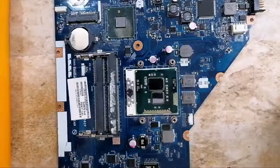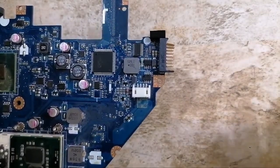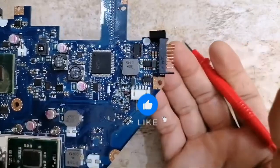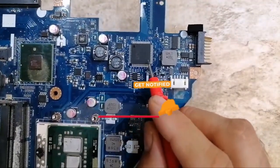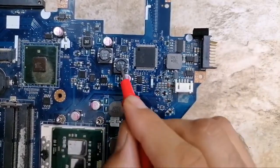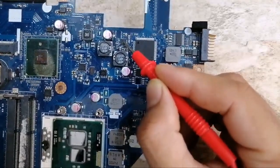How to locate the circuits in every motherboard without a schematic: when you take a motherboard, always try to locate first the DC connector and the battery connector. For about 90% of motherboards, near the DC connector and battery connector you'll find the charge circuit — like this one. You can find it on this side or on the back of the motherboard. Also, when you find two inductors next to each other, that means this is the 3.3V and 5V circuit, and this IC is the 3.3V/5V control IC.